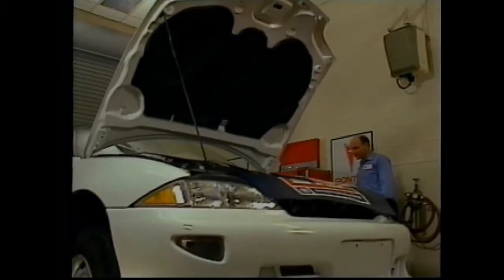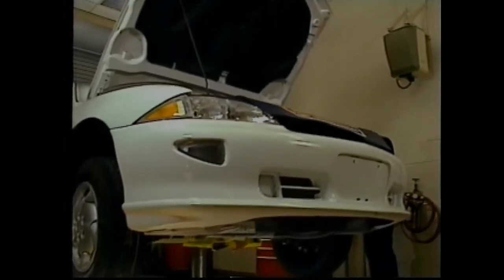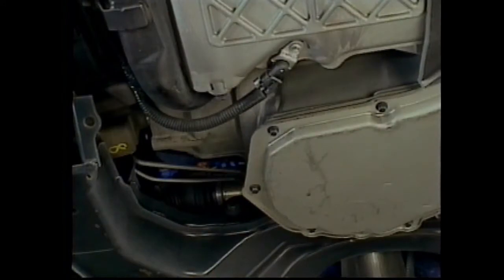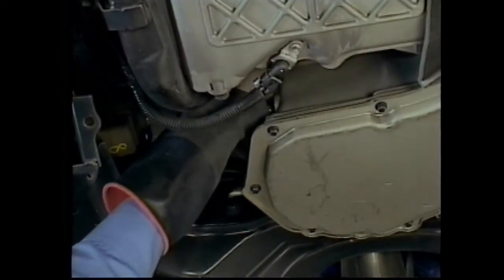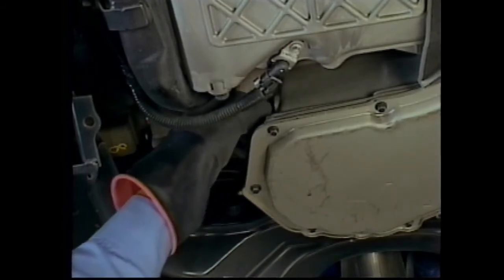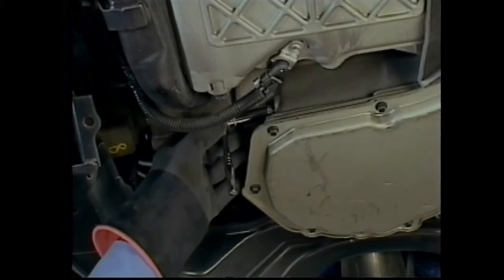However, if the system check reveals no DTCs, the transmission functional test continues with the fluid checking procedure. As shown earlier, the fluid should be level with the fill hole for the oil level screw. In addition, check fluid condition. Traditional diagnostic techniques such as burnt fluid apply. If the fluid is okay, you must verify the customer complaint. Two tests are used: the electrical garage shift test and the road test. Here are the highlights of both.